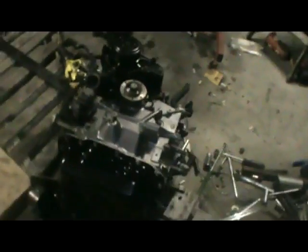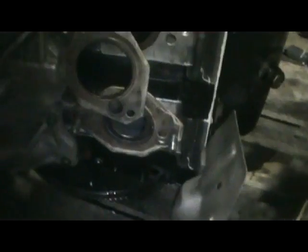That's coming along pretty good — I just got to put on the turbo manifold now, it's starting to look pretty good. I got the exhaust manifold right here with the gaskets. One of the studs came out when I was taking it apart, so just got to set that in — the holes go towards the back of the engine on both of them. The exhaust manifold's on there and torqued down, so now I have to put the heat shield on over top of it. I got the turbos on there — it was a bit of a pain because all my studs came out. I'm going to start working on putting the heat shields back but it's night time, so I'll come back in the morning and do all that.